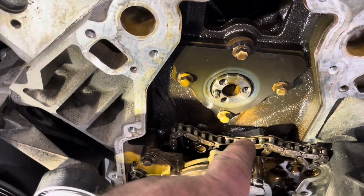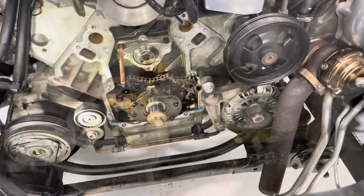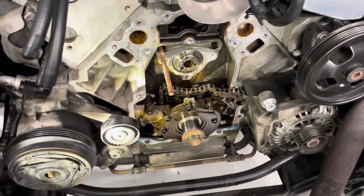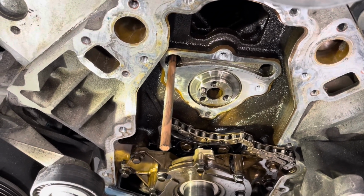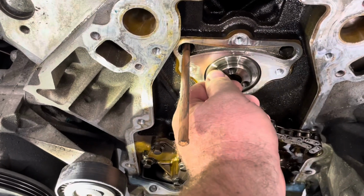Cam retaining plate, it's the next thing come off. Look to be 10mm bolts, 4, get the plate off. Backing plate's off. And you can see I've pushed a 8mm timber dowel in there that I've greased up. That holds the lifters, helps hold the lifters up.